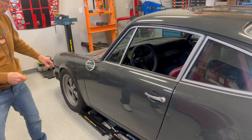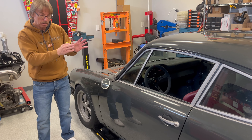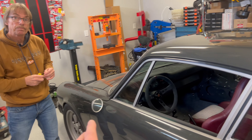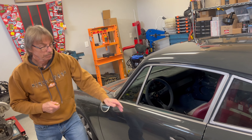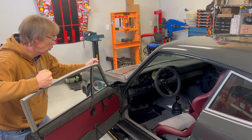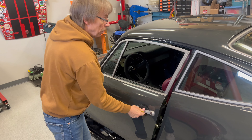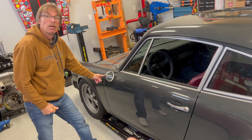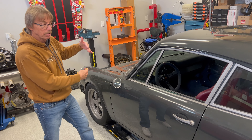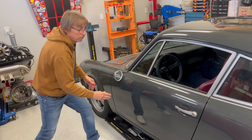So this one's worked out pretty good. At this point we're not concerned about this fender whatsoever. We're going to go fix the other door to get as good results at those transition points. Once we've got that one, we'll move on to the hood and the cowl. One thing to mention: we took the bolts loose at the hinges and then raised the door — brought it up and also pushed it in. Everything we do here affects what happens back here. Once we did both of those adjustments, the door was closing like a Porsche door — it puts everything in better alignment on the hinge pins.